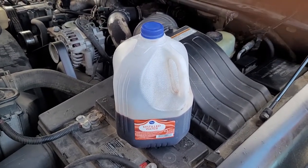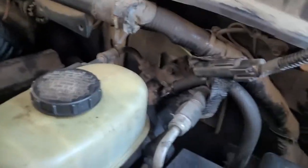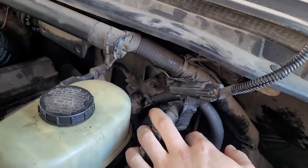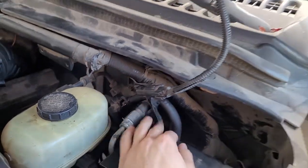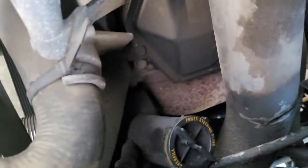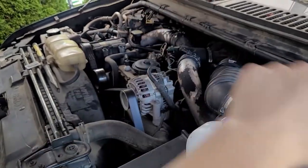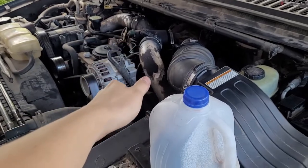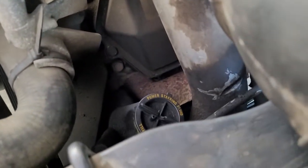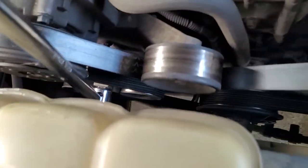Before you install the new pump, make sure to flush your power steering fluid — here's the old stuff that came out of mine. To do that, disconnect this line off the hydro boost, leave it in an upright position, connect a clear hose to the fitting, and run it down into a jug so the fluid collects there. Remove the reservoir cap and top it off. Turn the steering wheel left and right, pump the brakes a couple times, top it off — the old stuff comes out. Make sure you use ATF, not power steering fluid.